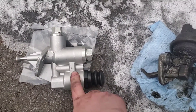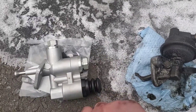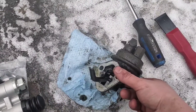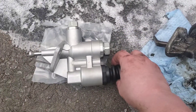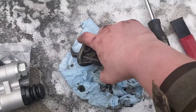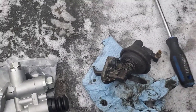The reason you want to go with one of these is it's a little more reliable than the diaphragm pump and has higher flow, so it can support more horsepower. The diaphragm pumps leak internally and you'll get fuel going into your engine oil, whereas these tend to leak externally, which is a little better. These can still leak externally if the gasket is shot — mine was leaking engine oil everywhere.